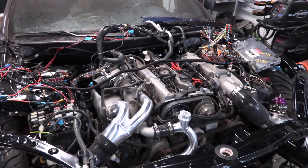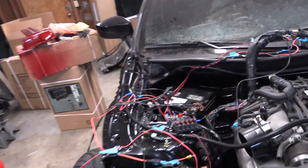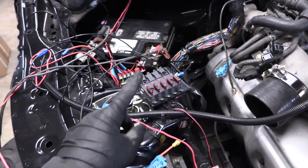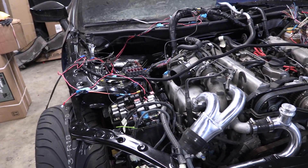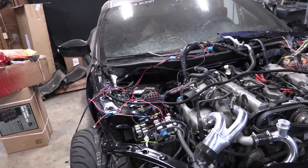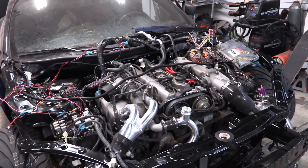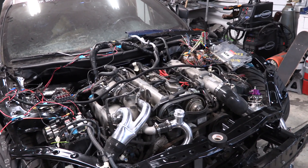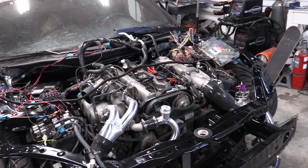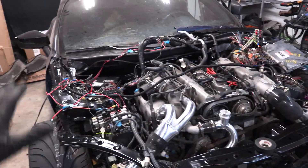Massive wires update — we're about halfway there. We've got all the ECU wiring running across in one nice neat cable. We've got our fuse block here — this is all our fused power connections. People mentioned we didn't have enough fuses; we've remedied that problem, we're all fused up. I've got to get something similar for the ground. The goal right now is to get this thing rewired the way we had it during our original wiring, hit the button, give it a start, and make sure it starts back up before we continue on with our full-on modifications.